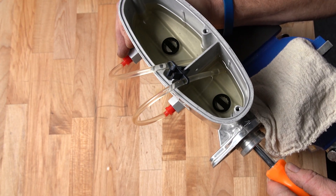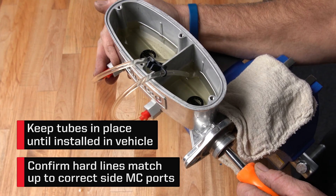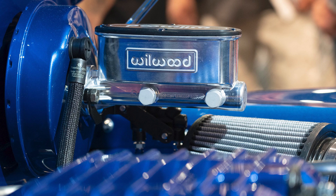It should become harder to push and take about five minutes to complete. Any tiny residual bubbles you see in the tubes or reservoir could be from the plastic fittings and will be purged in the vehicle during the full system bleed. Be careful not to introduce any air when moving your master cylinder back into your vehicle.